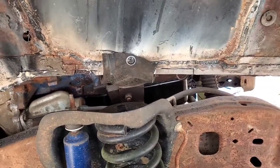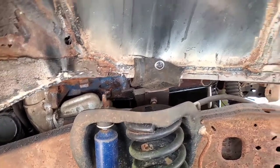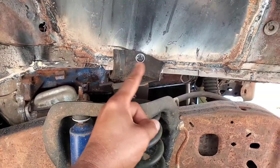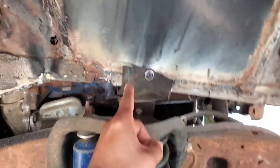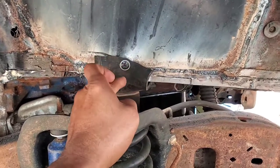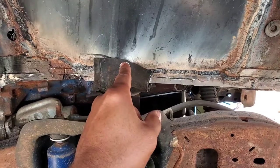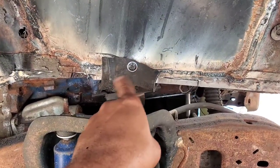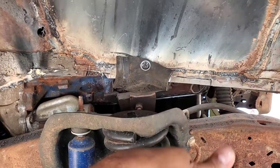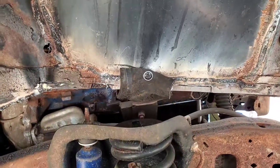A little extra thing I decided to do to help in the cushioning of the body on the frame was add a couple pieces of cut rad hose along this top of the subframe here, where it sits right over the Ranger frame shock towers. I just slit it in half, wrapped it around the flat surface right there, and attached it with a self-tapping screw. And when it lowers down, that rad hose will be between the body and the shock tower. Not a major concern, but it'll help lessen some of the metal-on-metal contact,